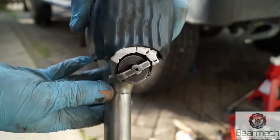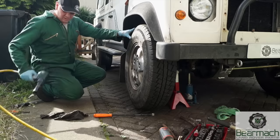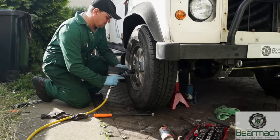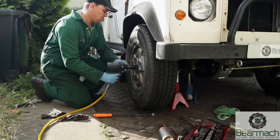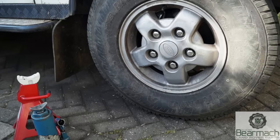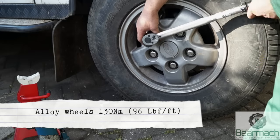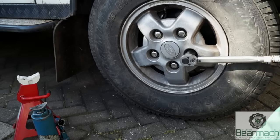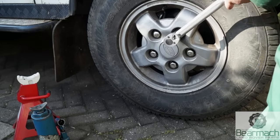If you're using any type of air tool, make sure you are not set on the highest setting and going over the torque setting required for the wheel nuts. Basically we'll do the five-studded star shape — doing opposites of the one before. The wheel nut is roughly tight. We'll then take the axle stand away and torque the wheel nuts. The torque wrench setting for alloy wheels is shown on screen. We are dealing with alloy wheel nuts and will do the five star pattern first, doing opposites as before.